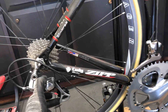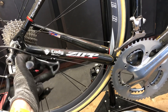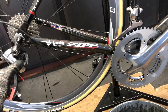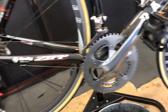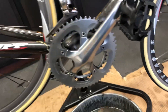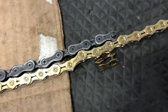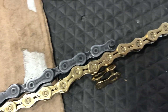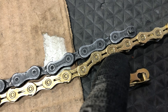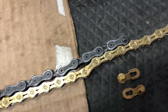You shouldn't really be in big-big intentionally, but you want to make sure the chain won't completely stretch out and damage the derailleur if you end up there by accident. That's the only issue if you make it too short. So we're going to use the chain tool and chain breaker, punch this pin out right here, put a little dab of lube on there, and call it good.